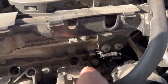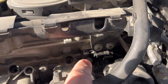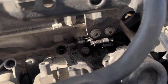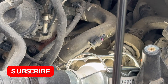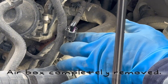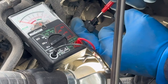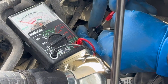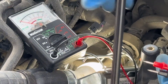But once you get the bolt out, use a magnet to aid you so that you don't drop any bolts. You need something like a very small tiny T30 with an open wrench and just go that route. I didn't video because there's not much room to show you there. One thing I want to test is this connector for our crank sensor here — I just want to make sure that there is at least 4 volts coming out of here with our key on, basically to make sure we get some continuity on our electrical system. There you go guys, as you can see there's about 4 volts. So that's about right, we should be okay in this regard.